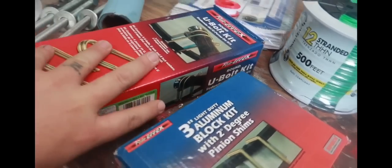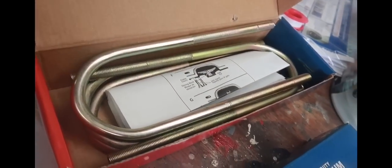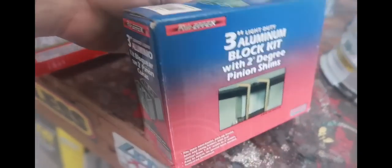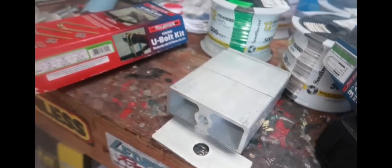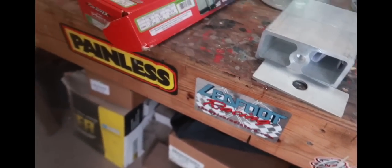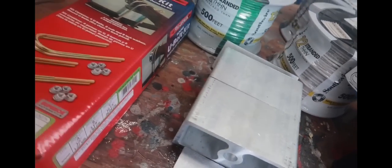The parts I bought - it's just a u-bolt kit. You gotta make sure you get the round ones for the mini trucks, for the low S10. Then we got an old school three-inch lower block. I went down to O'Reilly's and bought these - they're a little bit more expensive. These are the long arm blocks, they come with shims nowadays. I think three inches is gonna be good to get the truck down just right. You should be able to get this whole kit for like 25 to 30 bucks, but now you're gonna pay like 49 for the blocks and 29 for the u-bolts.